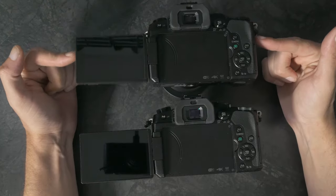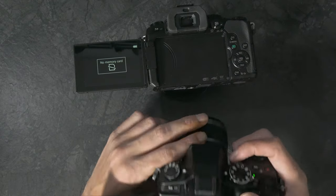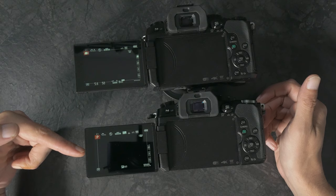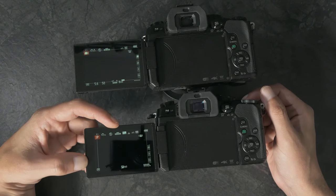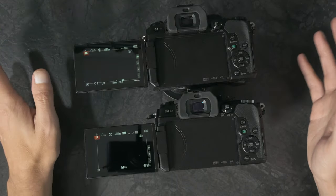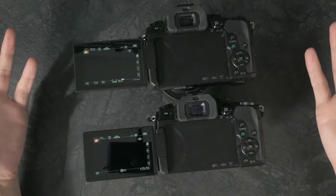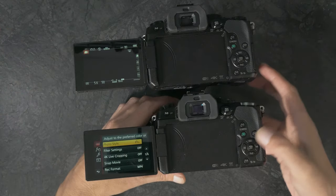So here I have my two cameras — this is the one with the dead SD card slot, this is the one I'm copying all the settings to. When I go into the custom one settings, the interfaces on the two LCDs look different. This one's set up for video, this one's set up for stills — it's got the wrong color profile. Even the video mode is set to Full HD at 50 frames per second; this one's set to 4K at 24. I'm going to pop this into movie mode so we see the same as that. It's automatically cropped for 16 by 9, and I'm only using these for video.